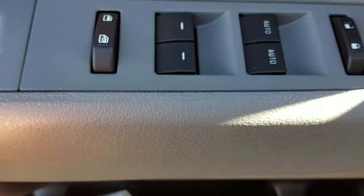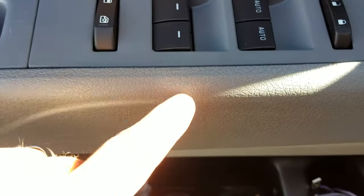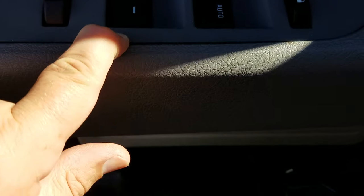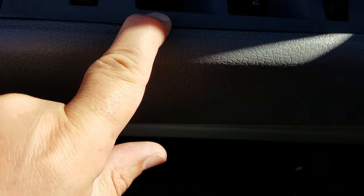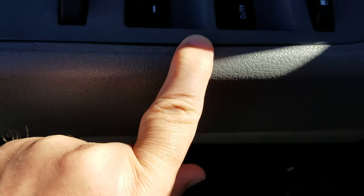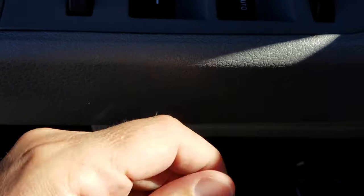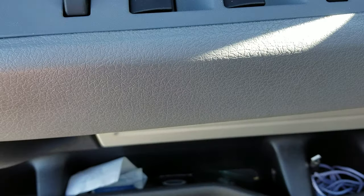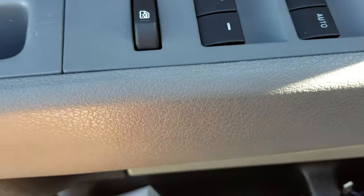Down at the bottom you can see one there and one there — so that's it, one, two, three, four. Then you'll need to pop out one more under there. Just basically pry that up, go toward the middle about a half inch and pry it up. This is pretty forgiving. They'll pop up, snap out, and you snap them back in after you remove that bolt so you don't lose it.